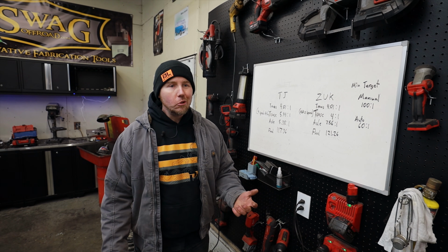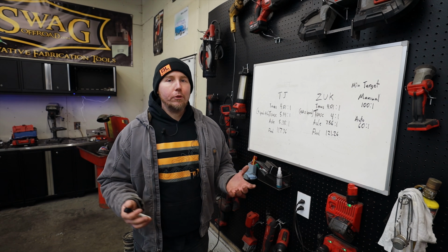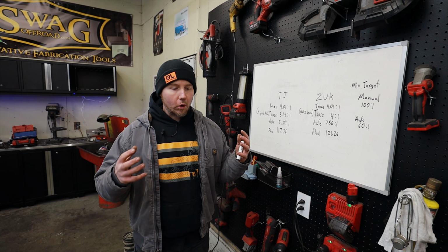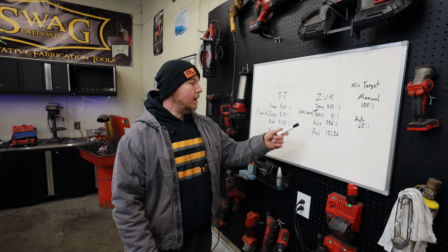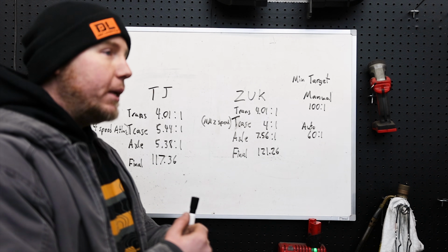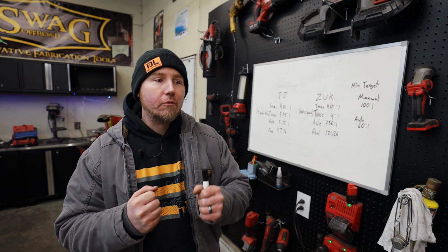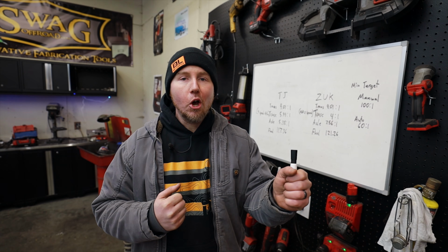And if you're going to spend $2 grand on a used case, and you can't even do front digs with it because you can't do a twin stick, I don't know. It starts to get hard to pull the trigger when you could start looking at something like a Midnight Metalworks. It's a more compact case. There's a bunch of different options for clocking because of the way it's machined. You have different transfer case gear options, and then you can do front digs because you basically have a lever that controls the rear axle separate from a lever that controls the front axle. So you can put the rear in neutral, put the front in low or high, and now you can do a front dig, which is awesome.